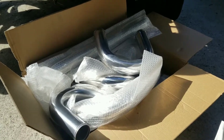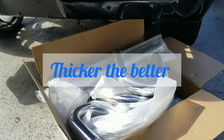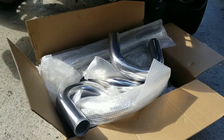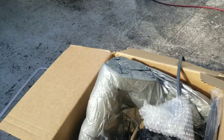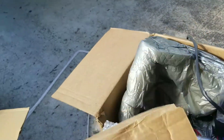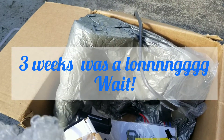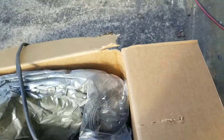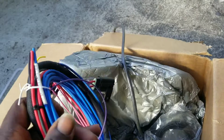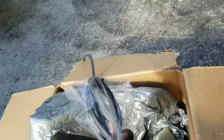The only other thing is make sure the thickness of the piping itself is not super thin — make sure you got some thick pipe for boost. You need something a little bit thicker than a naturally aspirated filter pipe. Other than that, just make sure you get all the pieces you need. The Holley — already opened it up, couldn't wait, like a kid in a candy store. Got a manual, got our electrical components: relays, fuses. That's for the crank trigger or the magnetic pickup. CAN bus, USB.